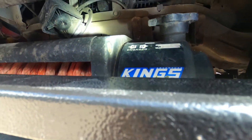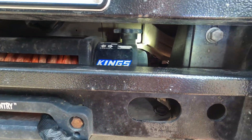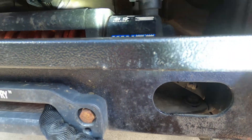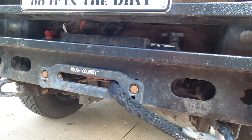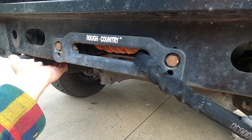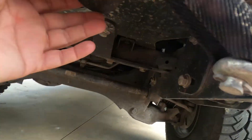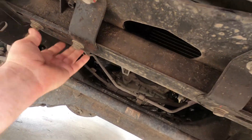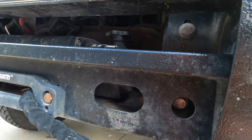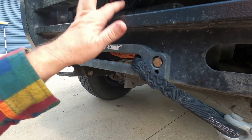All of the standard car alarm system and everything else stays there — it doesn't move. All you do is lift the winch up into position; I held it up there and tied the rope off on the top bar. Then put the cradle back into position and sat it on the bolt holes — it won't fall out, it'll sit in there. Drop your winch back down, bolt your four bolts up on the winch — one there and one there — then bolt your cradle down. You've got your main bolts on the cradle and one big one back through here.